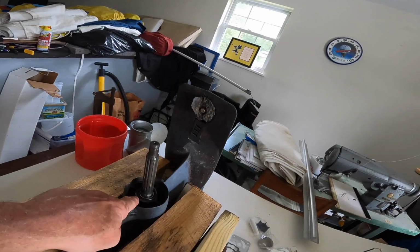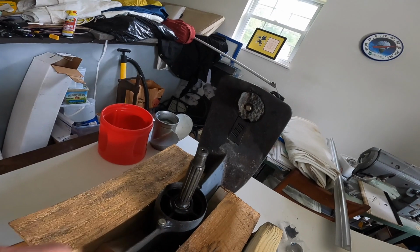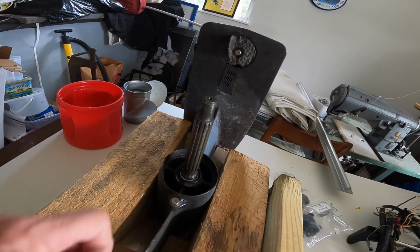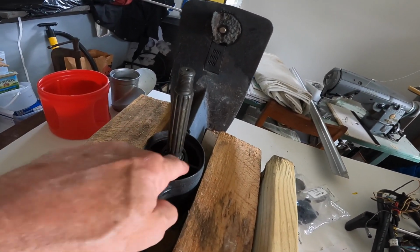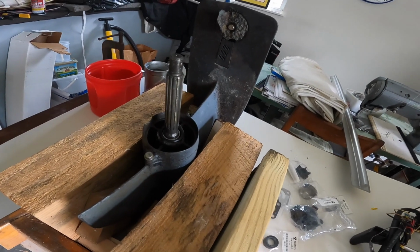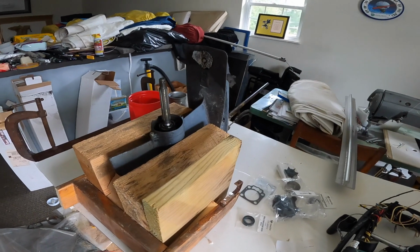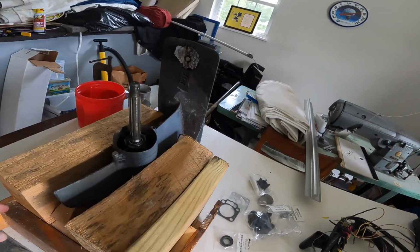But unfortunately, it's just got that bad corrosion right there, right around where that seal has to lip. And as long as the sides of the seal can make good enough contact to seal, even if you have to put some type of compound around it to get it to seal, that's okay too, as long as it will hold it in place and not move and not leak. So just kind of a quick and dirty fix, but I only gave $50 for the motor, so I think it's going to be worth messing with and see if I can get it fixed.